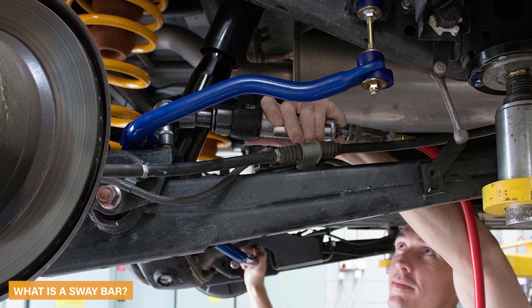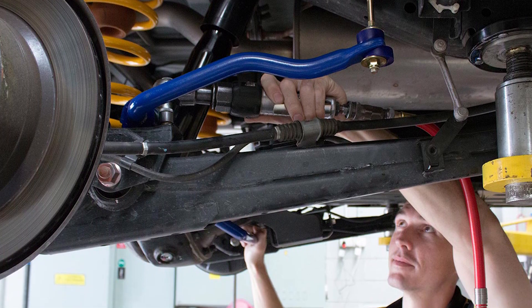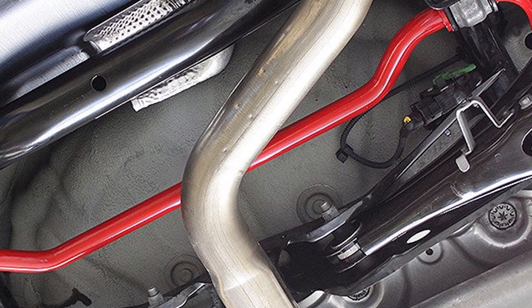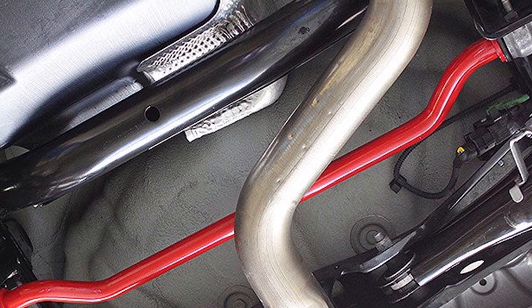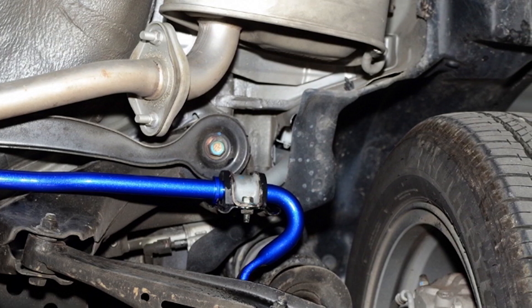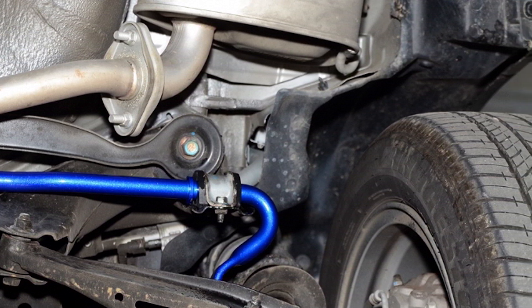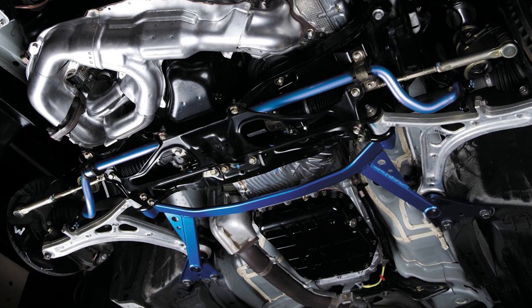What is a sway bar? To be clear, sway bars are very different from strut bars in function. A strut bar is designed to be inflexible, but a sway bar is specifically designed to flex. Instead of aluminum or normal steel like a strut bar, a sway bar is constructed of spring steel, like a suspension spring. Sway bars, which act directly on the suspension during cornering, have a very specific thickness and construction to achieve a desired spring rate.